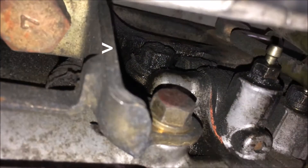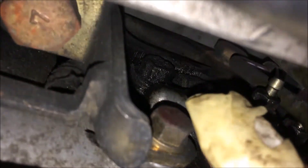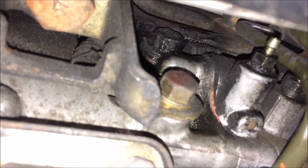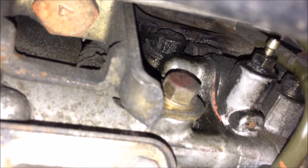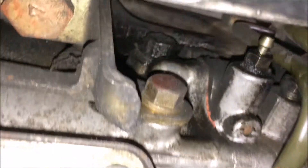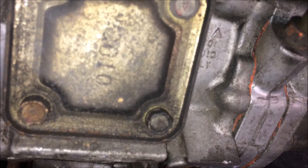The fill bolt is at the top — it's a standard 17mm. Spray it with WD-40, let it sit for a couple of minutes, then open it. These are your two bleeders; I've taken off the bleeder caps. Once you open the 17mm and the 24mm bolt, let all the fluid drain out, and then I'll show you what to do at the top with the reservoir.